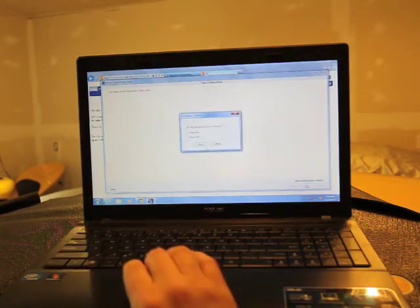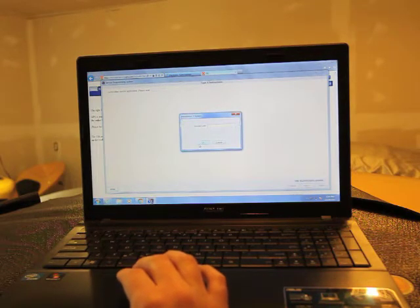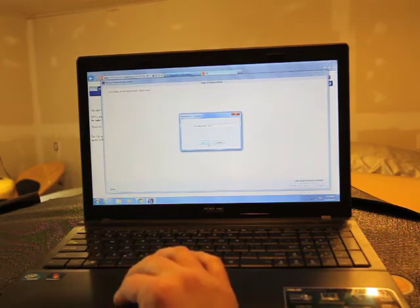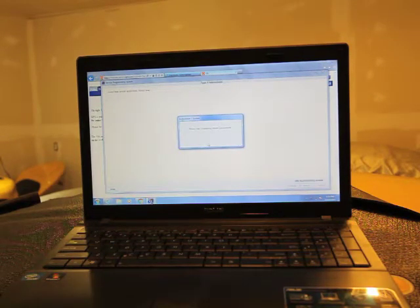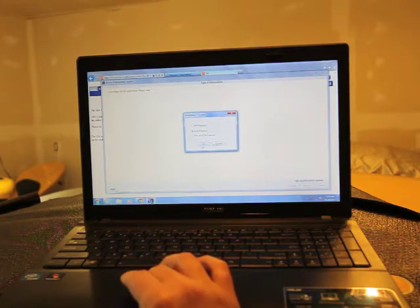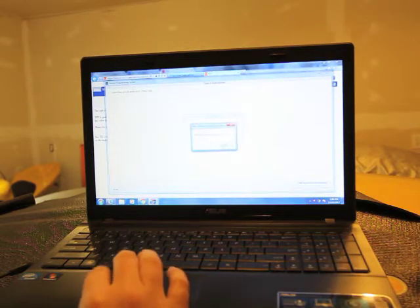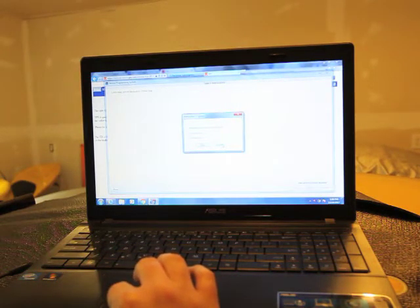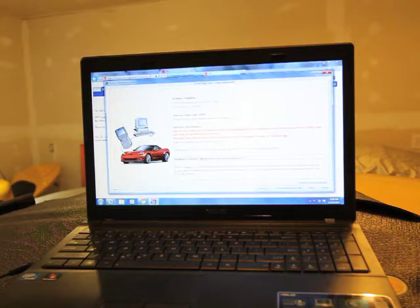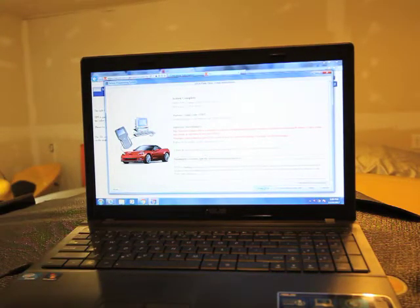We'll go Next, it's going to launch a special application — PIM to PCM, or PIM link to ECM — we select Next, and it's going to ask for the security code of the vehicle. We put in our security code. Now it's going to initialize the PIM to the PCM. We select 'ECM was replaced.' Now that the PIM has been relinked to the ECM, let's go ahead and clear the DTCs one more time. That'll pretty much be it for the install of an ECM into an 05 GTO. This procedure is very similar to what you're going to do on any GM vehicle.